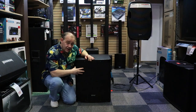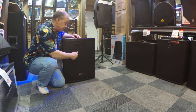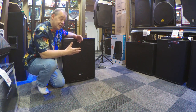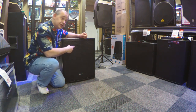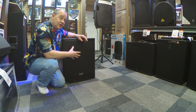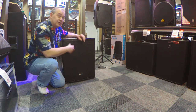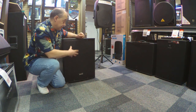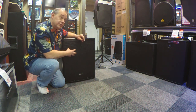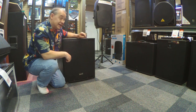Let's take the cover off and take a closer look. The cover itself is heavy gauge, solid, and slightly curved, so we're not going to get a lot of flex or vibration out of it. It also has a diffusion mat behind it, which helps get the sound through the cover without hitting it so hard that it causes vibration — what's called a cover effect, where the driver makes the whole cover vibrate and produce its own sound. The diffusion mat cuts that out. It's nice to see they took the time and extra money to include it, because some companies don't bother.